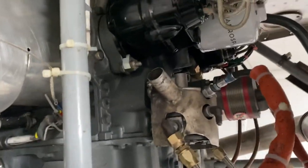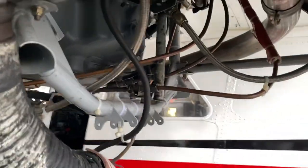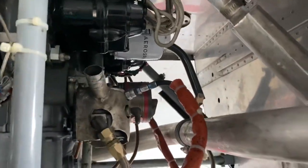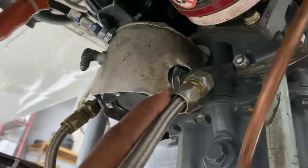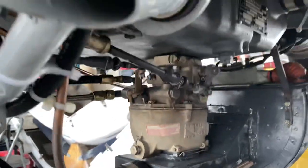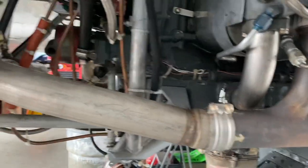Here we have the engine-driven fuel pump. If we follow the lines we'll be able to tell where the fuel comes from. Fuel comes from the fuel strainer which is inside here, comes through and passes all the way down into the engine-driven fuel pump, after which it goes right back down into the carburetor — and that's how the carburetor gets fuel. There is also a breather or vent for the fuel pump where excess pressure is blown off, just so the pump can breathe, as the name suggests.